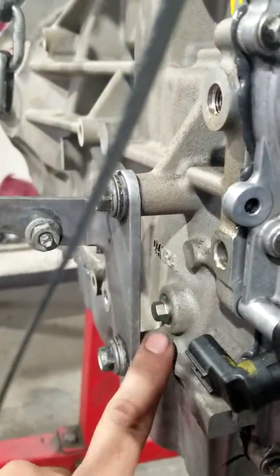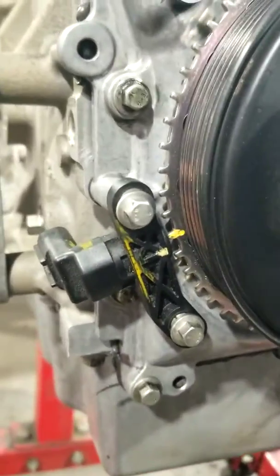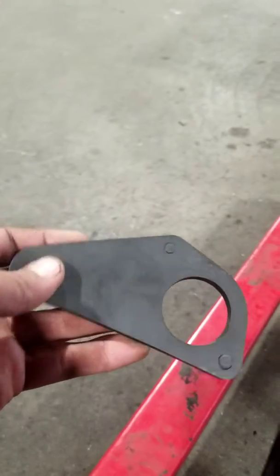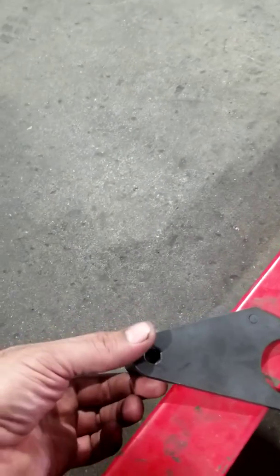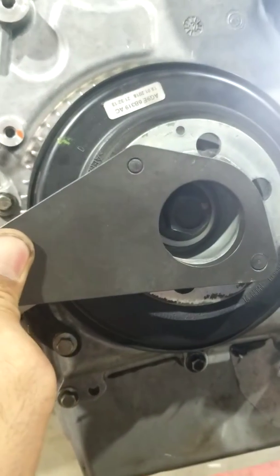That plug — remember, you've got to pull the axle and the axle bracket when it's in the car. You don't have to pull the whole subframe down to do this. You can see the paint marks, but there's a dot where it lines up. This tool kind of snaps over your crank sensor and marks which gear you need so that lines up. This other piece bolts to a pedestal, and a long Allen bolt goes through it and bolts into one of the bolt holes for the crank sensor, then locks into the balancer.